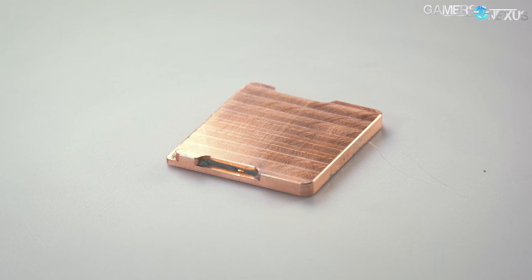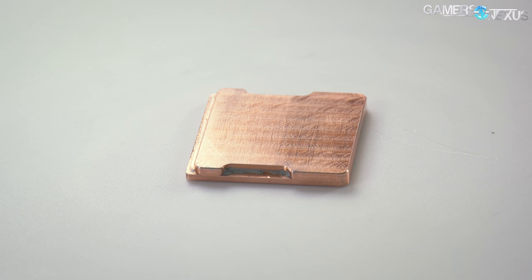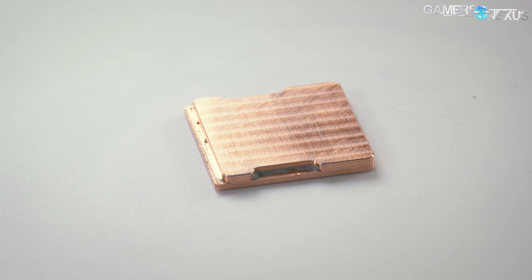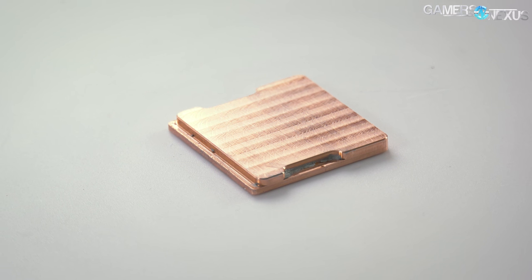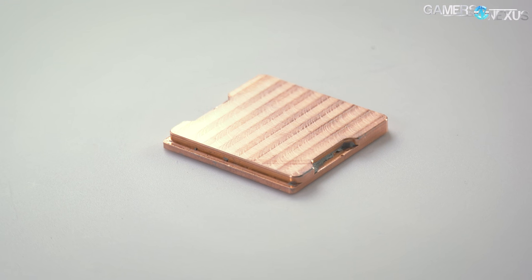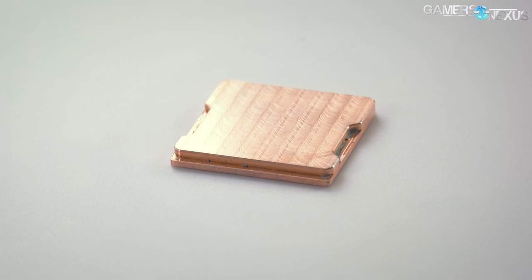And I would recommend it if you're just kind of like, you want a Saturday project. You want to play around with computer parts for $20 for an hour or so. It's a pretty good project for that. But outside of that, it is a bit of work. It's not hard, but I did have to reapply it a couple times when I first went through with it to make sure I'd aligned it correctly, make sure the liquid metal wasn't sliding around underneath, just like any delid process. I mean, yeah, don't expect great things, but you can expect decent things out of it.